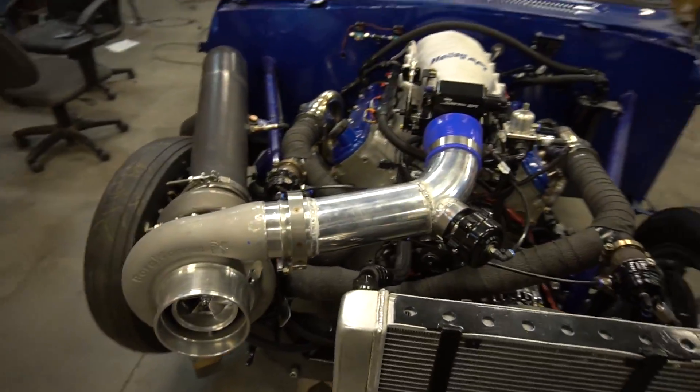No intercooler, and he's going to run it on E98 - I've used it and it works pretty well. He'll add a meth kit later once we get into some more boost, but just trying to get the combo all figured out. This is the first time the car's had any EFI in it, so he completely wired all that. I'm over here to throw a base tune in it, adjust some parameters, and see if we can get it to fire. I'll go over as much as I can in the software to show you guys how to set up a base tune for an LS.